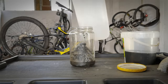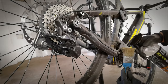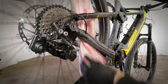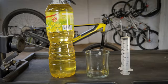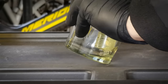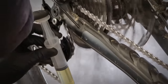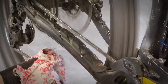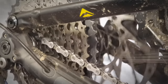This is actually a really good hack to clean a very messy chain — I would not do it every month or every three months, only when the chain is really full of grime. I then used my degreaser to clean the drivetrain and make sure there's no excess of other lubricants. I put the chain on the bike, applied the canola oil using the exact same technique I just showed. I noticed right away it was softer — it reminded me a little of Morgan Blue road lubrication. The drivetrain was clean, the chain lubed, and I was ready to go.